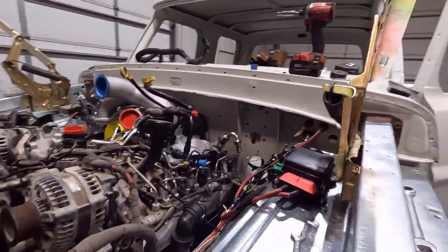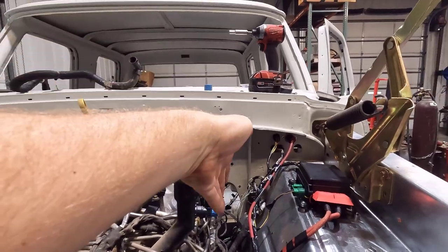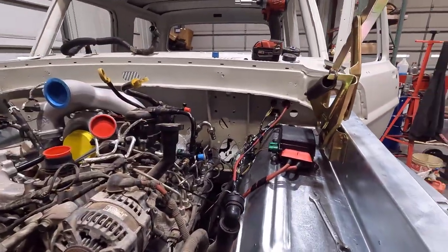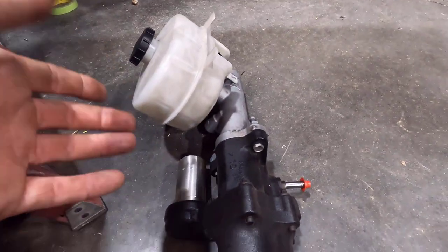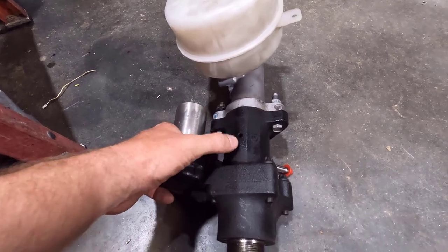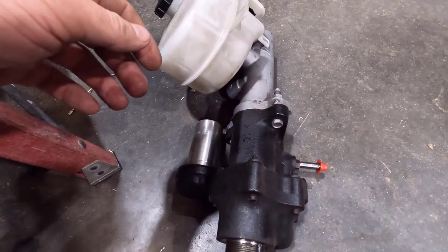When this truck had a 390 in it, being that close to the engine didn't matter because it's a smaller engine. But this great big diesel gets in the way. So I flipped it upside down — I don't think that matters. The only thing I didn't like is there's a drain hole right here: if you had a seal blowout on the inside, it would drain there, but upside down it could collect water. I might make a shield for that or a breather cap, or see if I can put a drain hole in a different spot. I might just do that while I'm waiting on other things. As far as the mounting goes, I got a blank hydroboost plate and traced out the holes for the firewall. I'll drill these out, and there's a nut that screws this on. I have to cut the bottom out so it clears the steering column seal, and then these holes here bolt to the pedal assembly — it sandwiches everything together with the firewall.